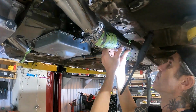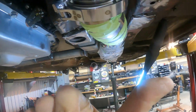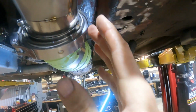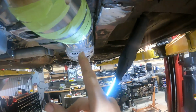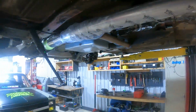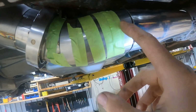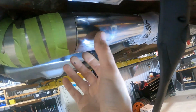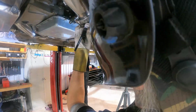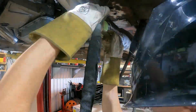Okay, I got my first transition all taped up. So you can see it does a jog over this way to get into the center of our channel, and then it starts to go up and then back to straight. So next step, I'm gonna start taking off each piece of tape, doing little tacks to our tubular piece that transitions into the oval. Once that's all set, then this section is all ready to go. We can start building off the back.